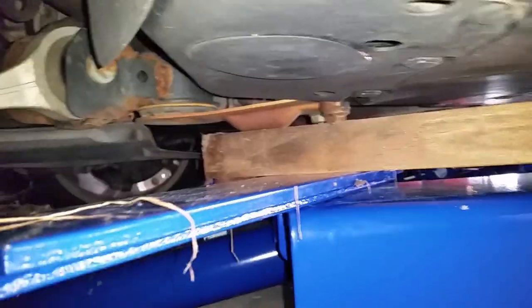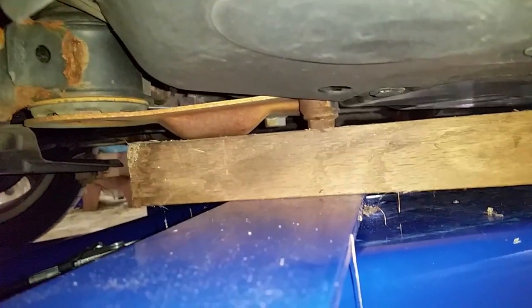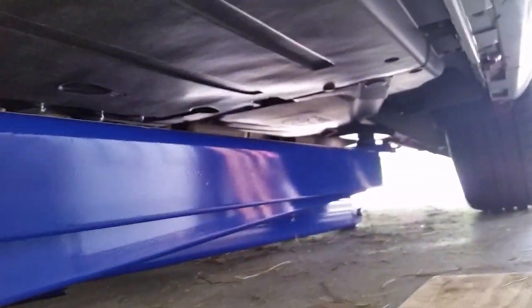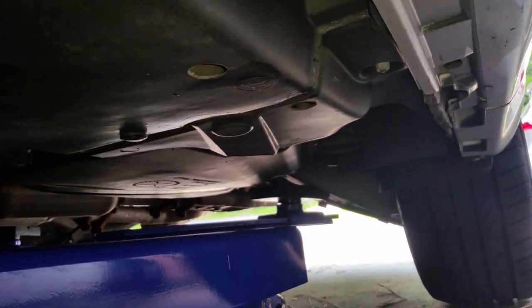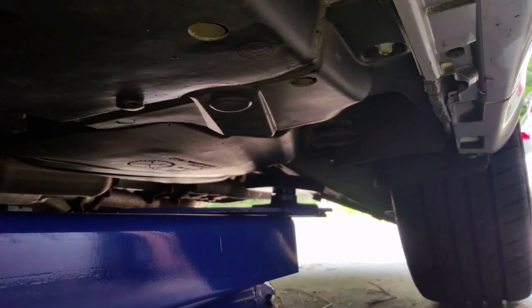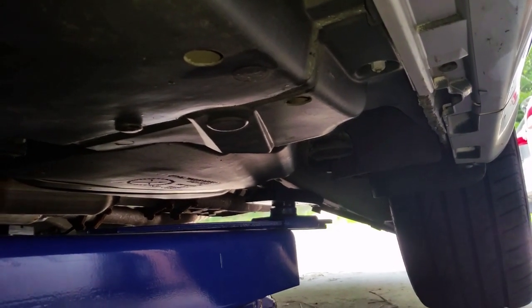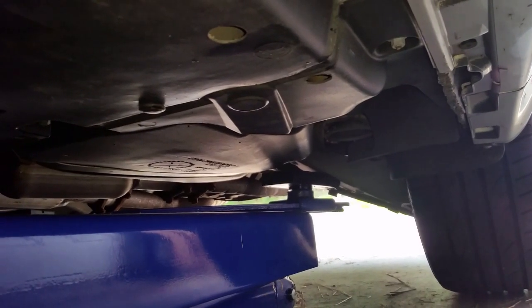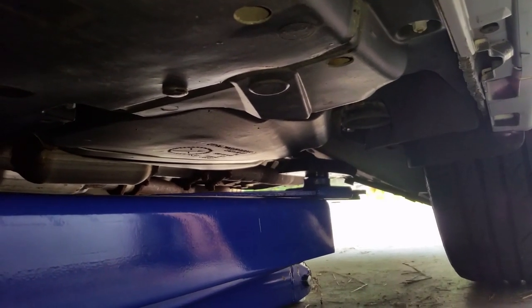So the same on this side, as you can see where the arm is. Get in there, you can at least get it lined up along the arm. You can see we're on the bolt of the forward jacking point. And on the rear, we're on the rear arm. Although it is putting a lot of force on that rear point, that is not really central. So maybe I'll take this back down, turn that around, see if I can get the force more down the center of that point, and we'll give it another go.